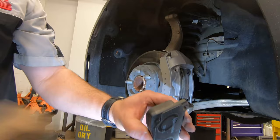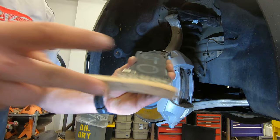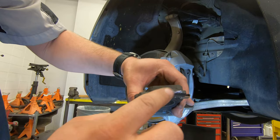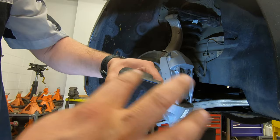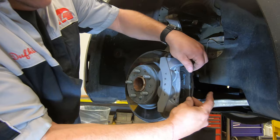Repeat the same step for the other brake pad — hit it with the wire brush. If it's really bad, you can also use a wire wheel on a power tool. Once the edges are clean, put a little bit of lube on your finger and apply it to the edges. Then go ahead and put the outside pad back into position. It might go in a little rough — move it around and it'll slide right into place.